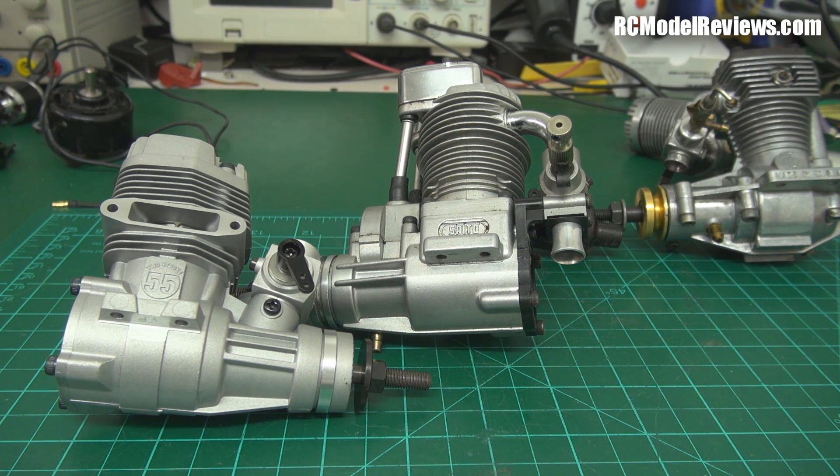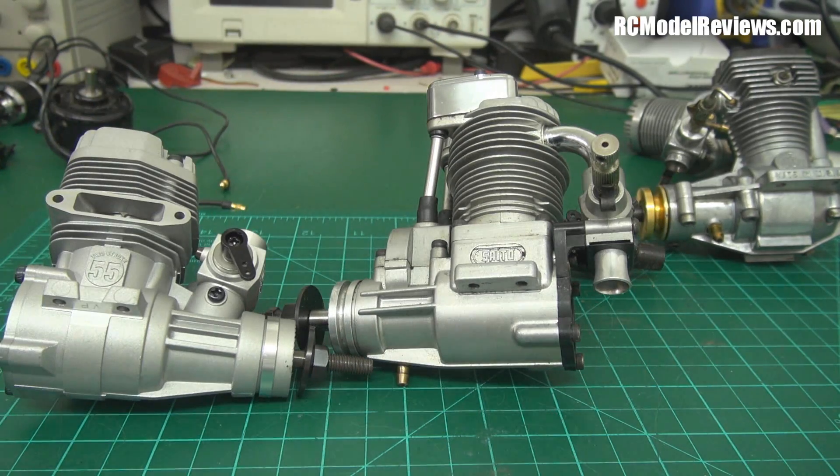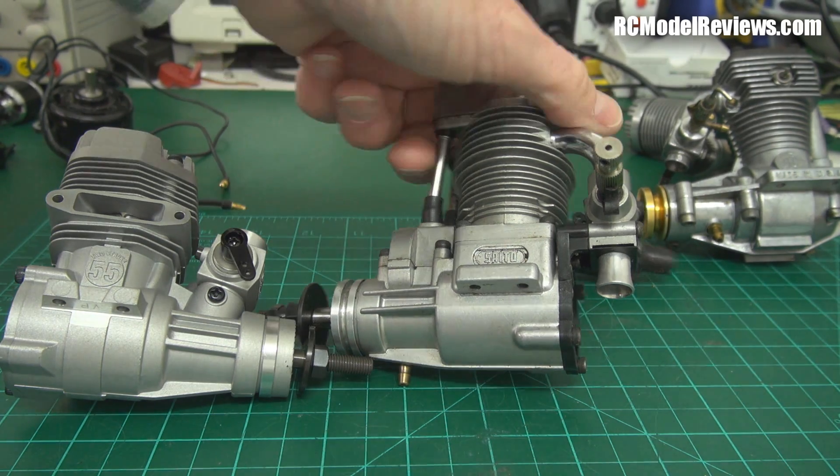I use a high-quality oil at low ratios. It used to be 20% was the standard oil ratio. These days, using Coolpower, a lot of people are running like 17%. I run 12% oil in all my motors. It provides excellent protection - I've never had a lubrication-related mechanical failure. I've had other failures, engine blow-ups you've seen in other videos, but those were due to metal fatigue and such, not lubrication. The good advantage of synthetics is they don't cause all this gumming up, they don't cause all this gunge on the muffler. Your motors remain pretty damn clean.